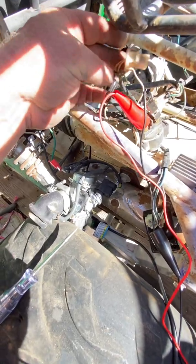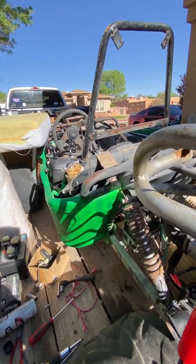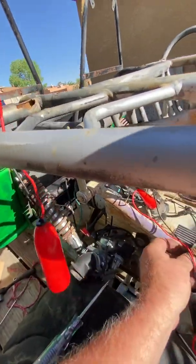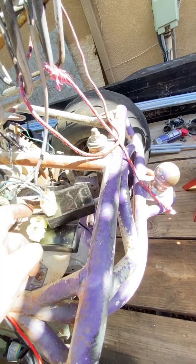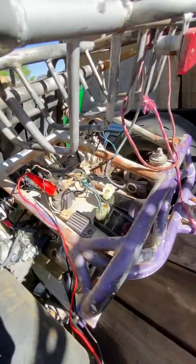The next thing you want to do — you want to make sure the wiring harness up here to the key switch and the button hasn't been messed with. On these particular buggies, I like to use the DC CDIs and not the AC CDIs. DCs are bigger. The AC CDIs have a power wire and then an off switch that kills them — those run off your alternator. The smaller ones run off your alternator; the bigger DC ones run off your battery. But as long as your charging system is working, it's charging your battery.